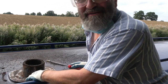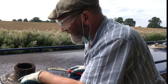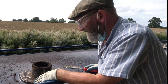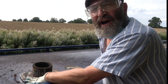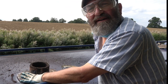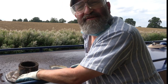It's cleaning up quite well. I'm not a perfectionist — I just need to make sure I've got a sound base on which to put the sealant. But I need to make this seal along here better where these join. I have done this before and it has worked. Once I've tidied it up, before I paint it I will treat the metal, because we've got back to bare steel. I will treat that before I prime it and paint over it.